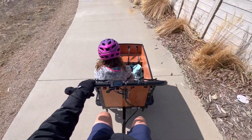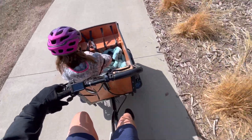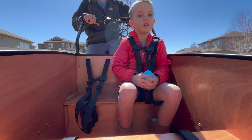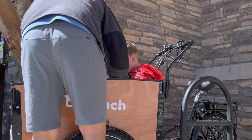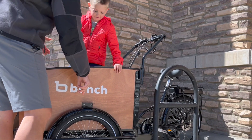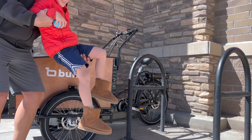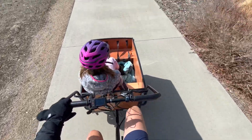The battery life on this bike is impressive. It's equipped with a 48-volt, 13.6 amp-hour lithium-ion battery made by Samsung. I was able to ride this bike for about 20 miles on a single charge using only the throttle with an empty cargo area. Your range will depend on terrain, cargo weight, outside temperature, and the amount of pedaling. I think 20 miles of range is great for this e-bike given how heavy and large it is. As the rider, you can significantly increase the range by pedaling or switching to a pedal assist mode instead of using only the throttle.